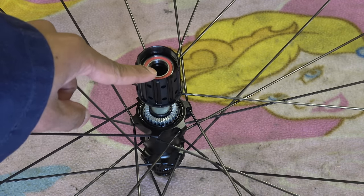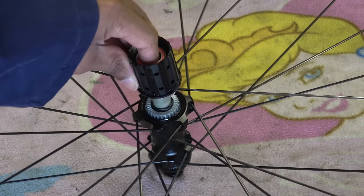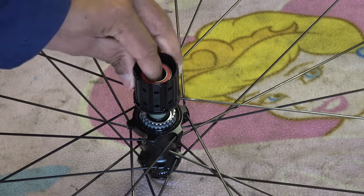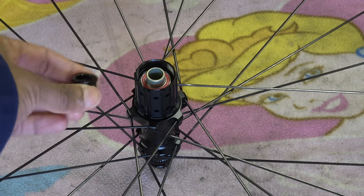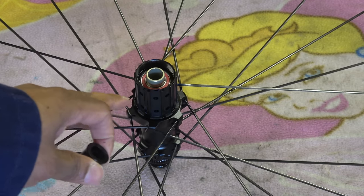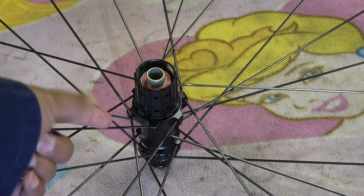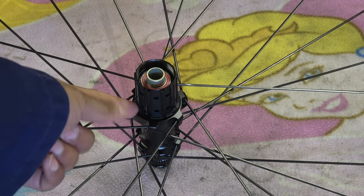Inside is the preload tube. You just push that down, get it lined up, pop it down and it slides — that's your entire assembly locked up, then you pop the cap back on. Now, because this is running steel spokes — all 24 of them on each wheel — you don't generate the same level of tension in the hub. When you apply the tension, it's not expanding the hub as much. So if you put carbon spokes on there, you will probably mess up the bearing clearance — bear that in mind because I know some people are doing that as an upgrade.